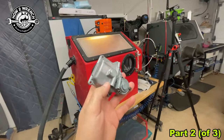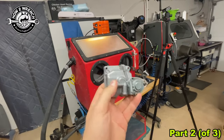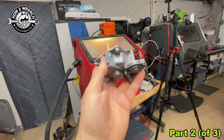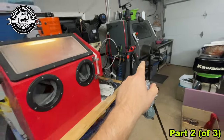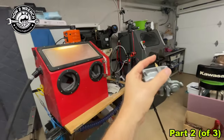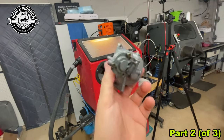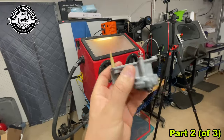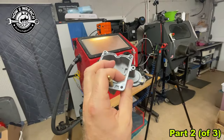I can't stress enough how much I like soda for applications on real world parts. I do a lot of engines, carburetors — stuff that I don't want to spend two hours cleaning, an aluminum oxide or a media out that I've got to be concerned about, an actual grit or something that's going to give problems. With soda, you could literally do this right on a bearing and wash it out. You could do it on anything and then recoat it right away so it wouldn't rust. That is pretty stinking cool.